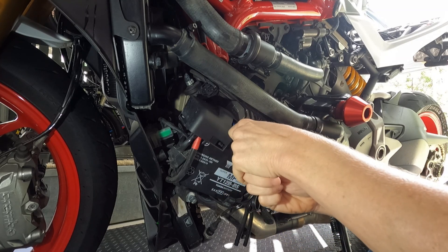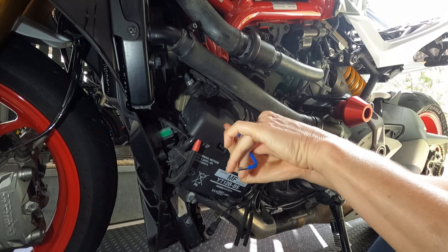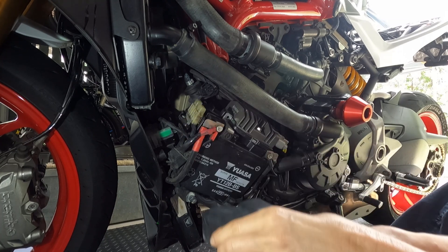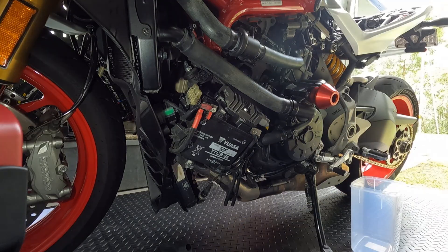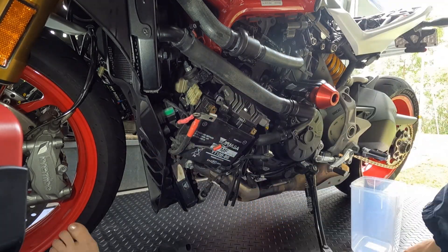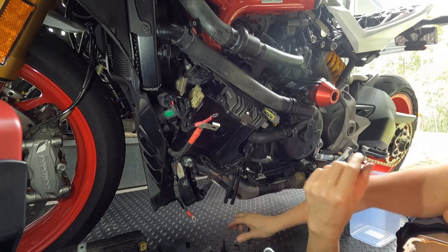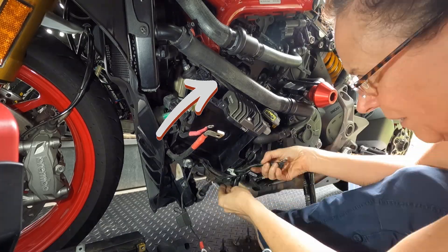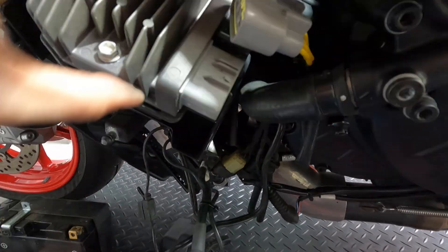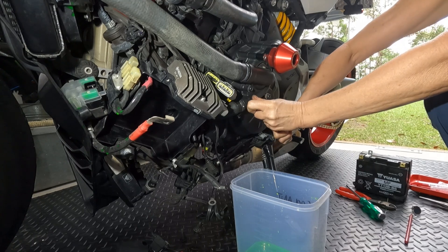First up, I was removing the battery to get access to the temperature sensor. I wasted probably an hour or more — and more than a few expletives — trying to remove the entire battery box as the manual said to, but too many things were connected to it, more than the manual showed. But I realised that if I just removed the water pump hose, that lower one, and let the battery box just kind of dangle down, I could reach the temperature sensor. So I went on to drain the coolant so I could remove that hose.